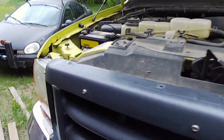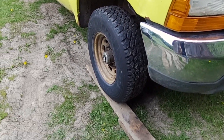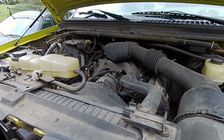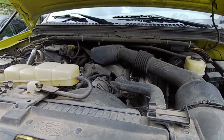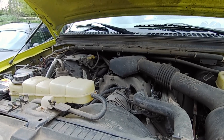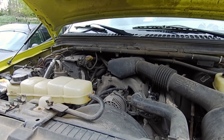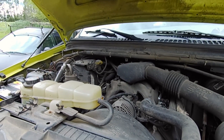I've just propped up my truck a little bit so that it's sitting nice and level. I have already warmed up the truck — it's up to operating temperature. That's a good idea whenever you're changing oil because it loosens everything up, and all the sludge in the bottom of the pan loosens up and allows it to drain out nicely.